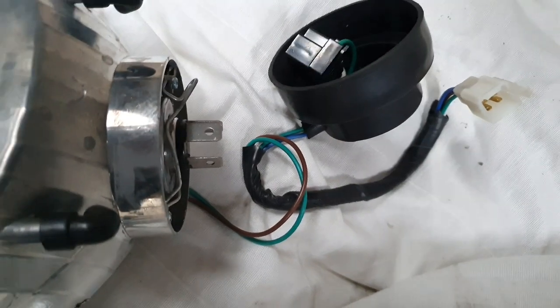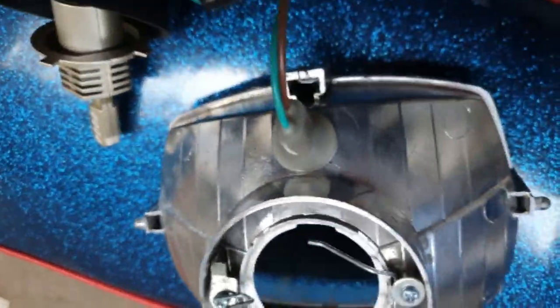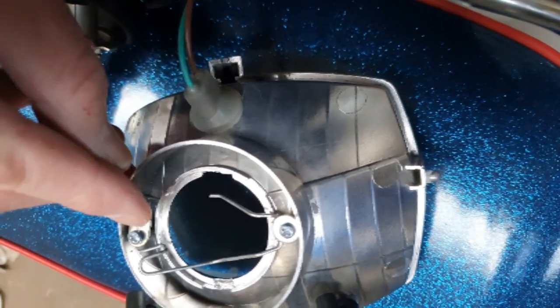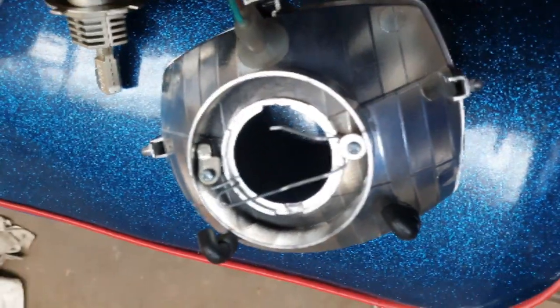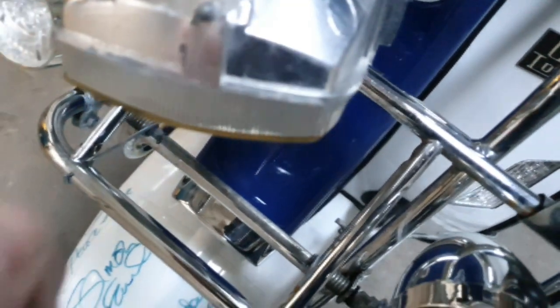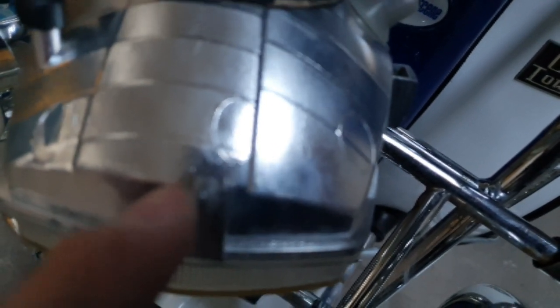I've slid the connectors off the old bulb, unclipped it, and I'm putting the new bulb in. A little tip when undoing the spring clip on the back: just lift one side slightly to let it ping out. If you undo both sides it can be a nightmare to get them back in. When refitting, the little clips on the side are fairly straightforward — almost spring-loaded, just manipulate them into the sockets. Also, on this little housing there's a small nut — make sure you don't lose that nut. It sits inside there and gives it something to attach to from underneath.